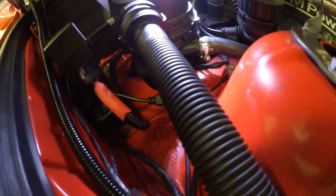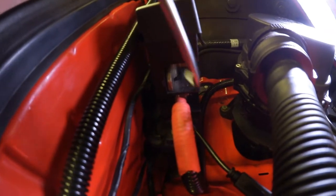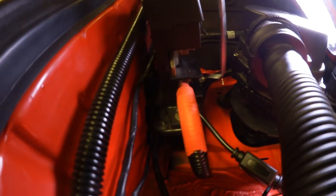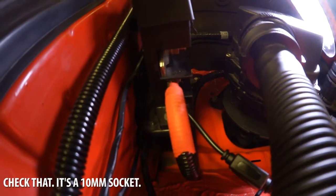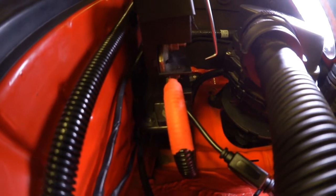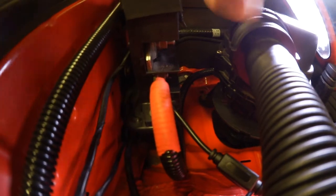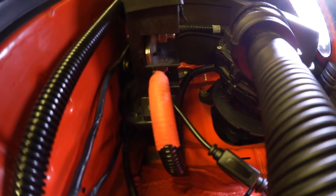The key is you've got to pop the cover off on the bottom portion of your positive terminal set. Then use the one where this big red cable is coming out — undo the screw under there, it takes an 11 millimeter socket. You don't want to drop the nut down in your engine bay — you may never find it again. Once you crack it, take your socket set off, keep the actual socket on it, and undo it by hand so the nut comes with the socket when you pull it out.